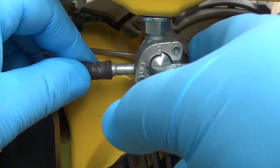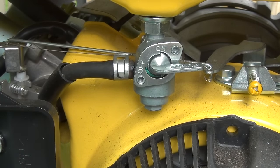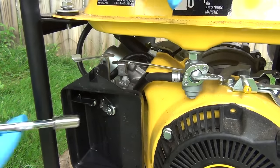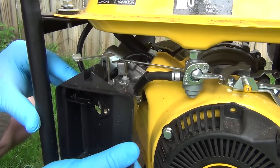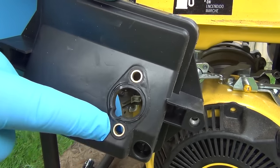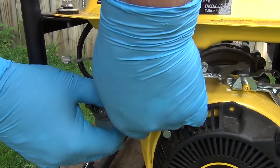When I'm done with this test I reconnect the gas line again. To make this easier and easier to see, I'm going to remove the air filter housing so the carburetor comes off and we can look into the carburetor more easily. This is only two screws in this case. When we remove this we have to make sure that we don't lose those little brass bushings and the rubber gasket. Now the carburetor is loose and we can pull this thing off after we remove the gas line from it.